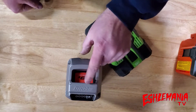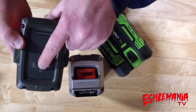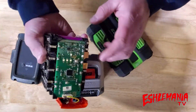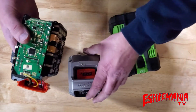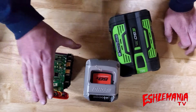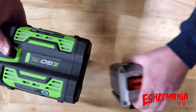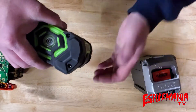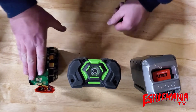The charger fan will kick on, and you'll get a flashing light or error message — on Husqvarna you get the red triangle or red light on the charger — because the battery management system is telling you the battery has to cool down before it can accept a charge. So you're waiting half an hour or so for it to cool, then another half hour to charge. With an EGO battery, it runs cool enough that you can pull it out and put it straight on the charger — it takes a charge instantly. What would have taken an hour with a block-style battery takes only about half an hour with EGO.